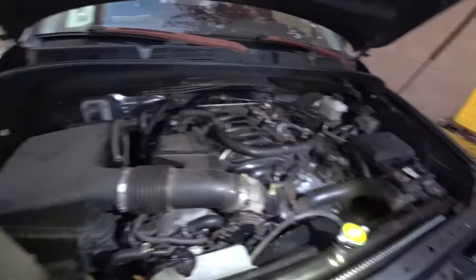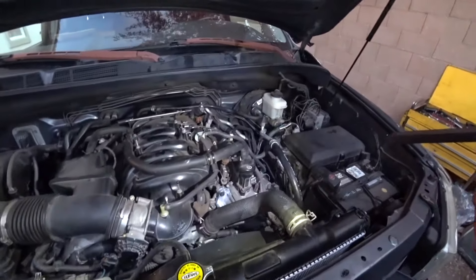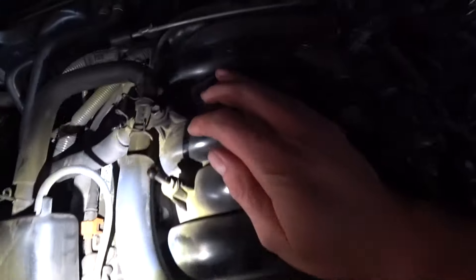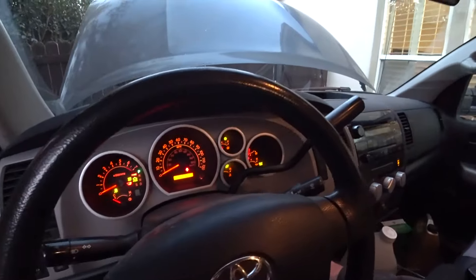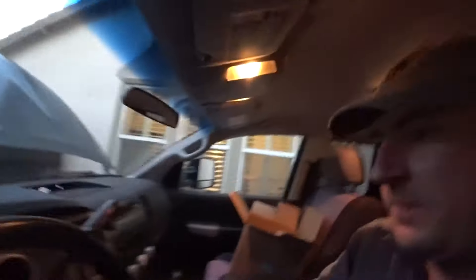I put coolant in and now I'm going around making sure everything is put back — no hoses or fuel lines forgotten. I connect the fuel lines and the breather hoses. Now I'm ready to start it. You could hear some noise at the beginning because the hydraulic tensioners are empty of oil, but once oil pressure builds up they fill and get tight. Now it's quiet and runs really well.